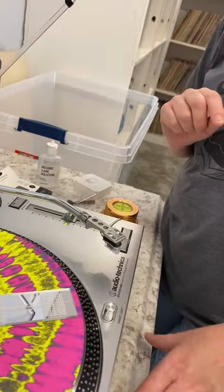Can you tell us what happens if you don't apply enough pressure or if there's too much pressure on the needle? Sure. If you don't apply enough pressure, your arm is going to jump and skip all over the place and not play properly. If you apply too much pressure, you could actually etch into your vinyl and there will be vinyl on your needle. I had a guy bring me a record one time that had the grooves cut out from playing his records with the needle he'd had since he bought the machine four years ago.